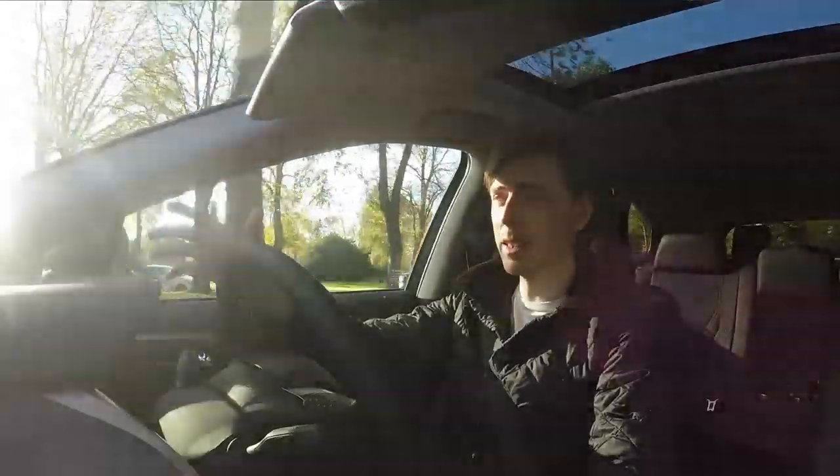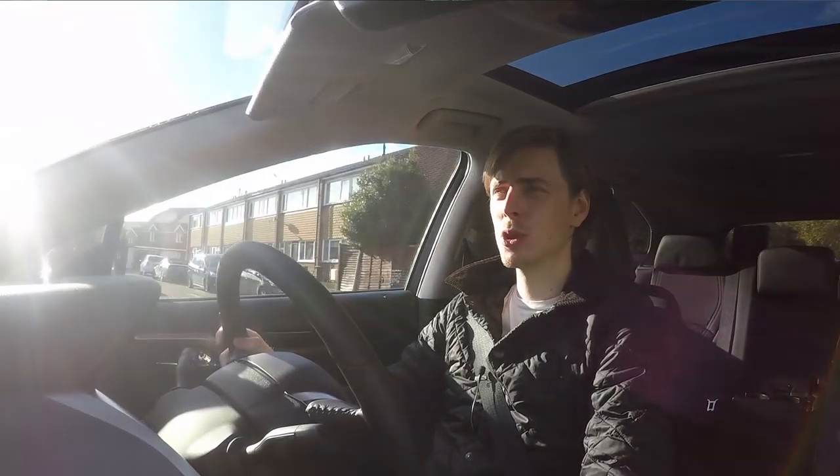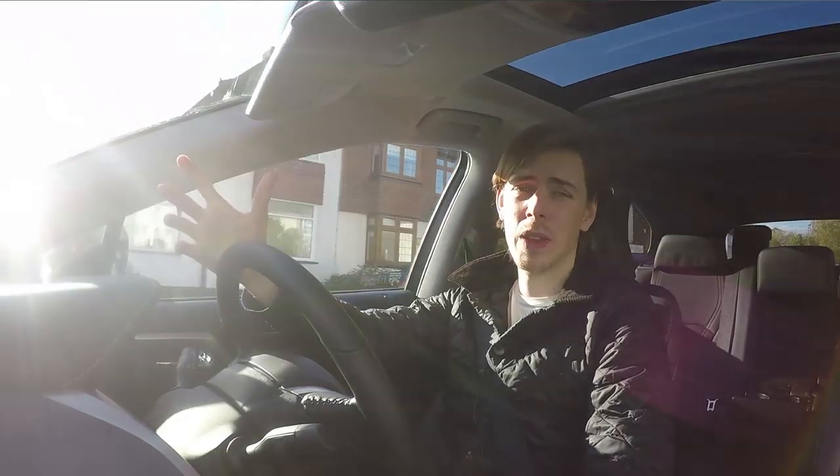But if you like to sit quite close to the wheel, or if you have fairly long legs like I do, what you find is that your leg is constantly banging against this bulge component. And rather than just being a bit annoying, it's actually quite dangerous because it can obstruct the free movement of your foot transitioning between the pedals.